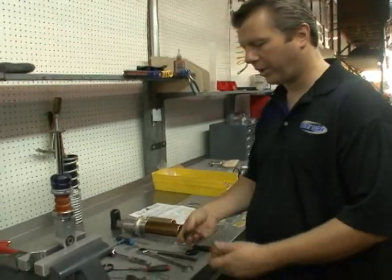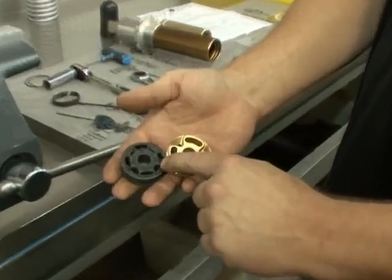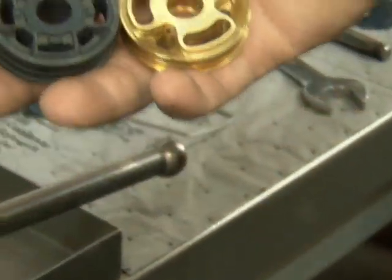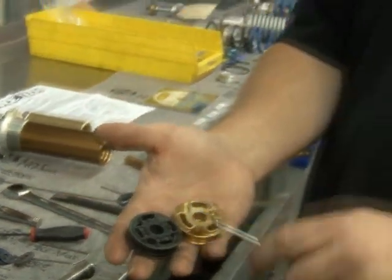The biggest deal with the gold valve — what we're trying to accomplish — you can kind of see the different port designs here, this being stock and this being the gold valve. What we're trying to do is open up the port area. As you can see, they're much larger. We want increased oil flow, which basically takes the question of port size out of the equation. If you're restricted at the port, there's going to be a certain point in the travel — what you've heard of as mid-stroke harshness, or more accurately mid-speed or high-speed harshness — where the lack of flow area in the piston can create damping in itself. We're trying to eliminate that so we can put the full burden of the setup on the valve stack itself.